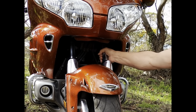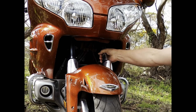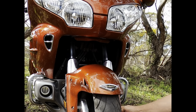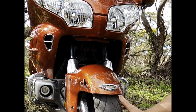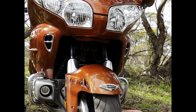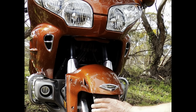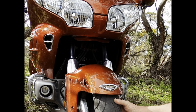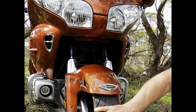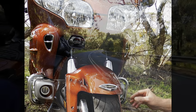The front forks are 45mm in diameter with about 5.5 inches — 140-odd millimeters — of travel. They're the traditional style with chambers at the bottom and shafts at the top, and they have an anti-dive setup: a slave cylinder on the left-hand side that pumps fluid back into the leg when the forks compress to prevent nose-dive. They're not race bike forks, but they're designed to give you that beautiful cushy ride you get out of this big tourer.